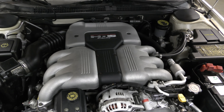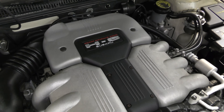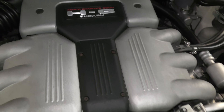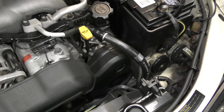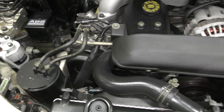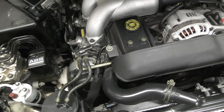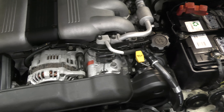It's a 230 horsepower 3.3 liter flat-six, or H6. This one has double overhead cams — you can see on the plastic timing cover there are two cams on each side. 230 horsepower doesn't sound like much today, but back then it was pretty decent.